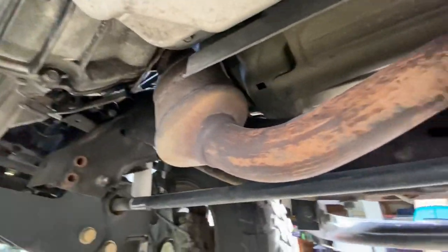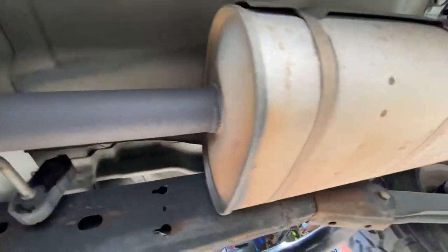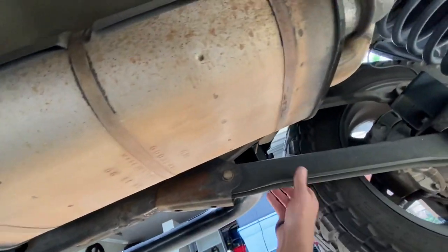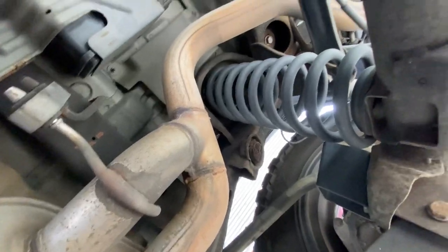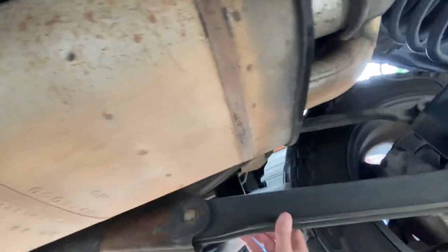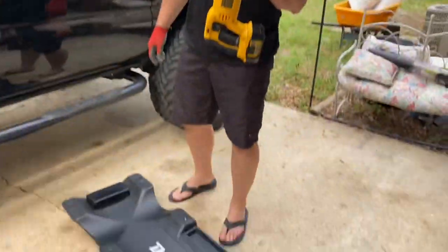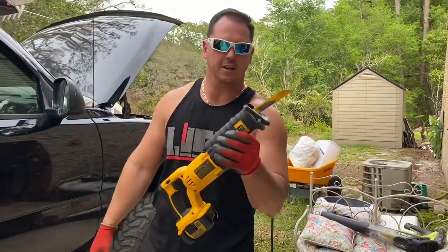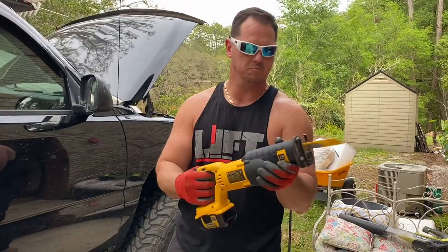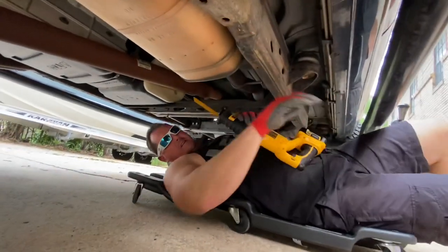Solidly quiet. So we got stock cats — I got the iPhone zoomed way out, hopefully it doesn't look too weird. It comes in to a two-into-one collector and goes into this massive muffler, all stock. What's a little screwy about the 2006 Tahoe is it goes into a double then back into a single all the way out. We're gonna sawzall and just cut it right there. We might need a longer blade, but that's all we're gonna do.